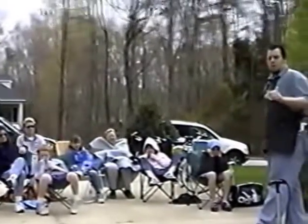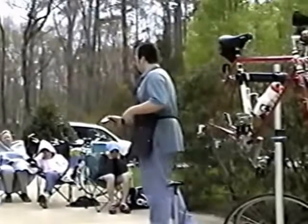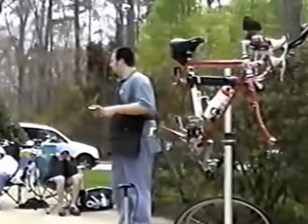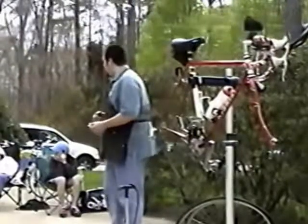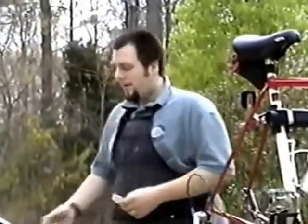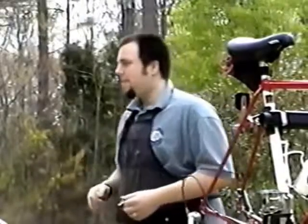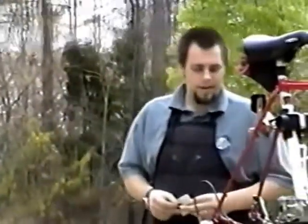If you were to have a flat and not be able to fix it, if you walk your bike a couple miles, are you going to damage the tire with the rim? What you want to do, if you do walk your bike, the best way to do it would be to, if it's a rear tire, lift up the rear of the bike and just roll it on the front wheel. Or if it's the front wheel, just lift up the bike so it rolls on the rear wheel. You don't ever want to ride your bike with a flat tire, because that will guaranteed ruin your rim very quickly. But if you are able to walk in an area that doesn't have concrete on it, if there's grass along the side of the road, the grass isn't going to harm the metal rim. That's fine. But the harder surfaces like the asphalt and the concrete are abrasive enough that it can really damage the rim, and you need to then replace it. So nothing catastrophic happens.